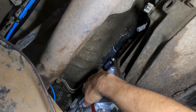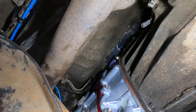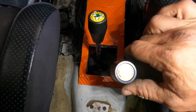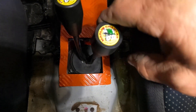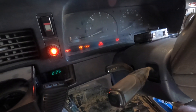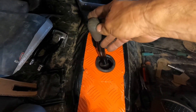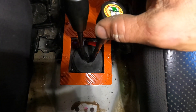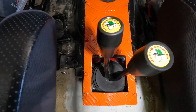We're going to be about six inches short on the four wheel drive indicator light wire, so I'll have to extend that. It's important because we can be in low range two wheel drive and I need to make sure that works. I'll extend this side so I've still got the factory plugs — that'll be four wheel drive, and that'll be two wheel drive, but I can still be in all my low ranges. I can disarm the front, so that's two wheel drive, come down one and that's four wheel drive, then muck around with the front case — low, low — that's low-low four wheel drive. I might have to make up a little plaque to remind me. Anyway, the light works — another protection to make sure we're where we want to be at the start of each event.